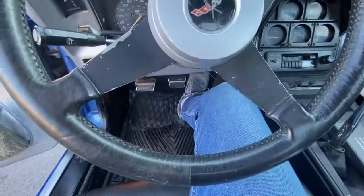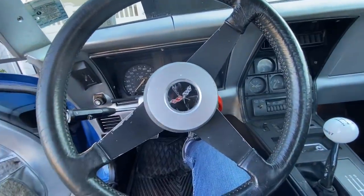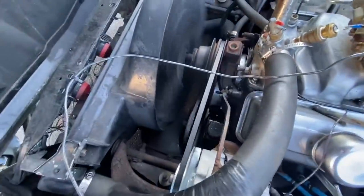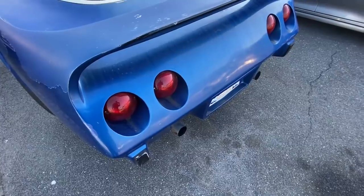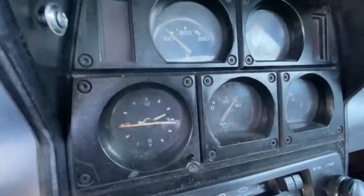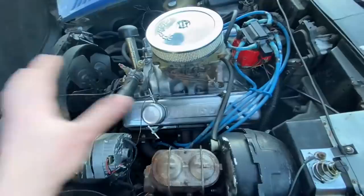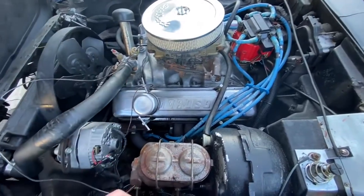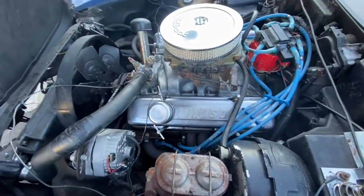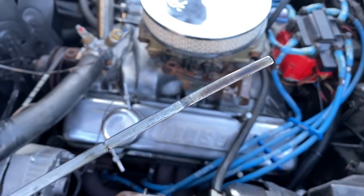I still have to sit here and just give it a little gas for a little bit, but not even close to the amount of time I used to have to do that. Just like that, it's already idling. It looks good down there. Definitely looks good. We'll cut it off for now. Every time I run it I do check the oil before letting it run for long, just because this is an old engine and it does have oil leaks. That takes two seconds and can save you thousands of dollars if your engine never locks up. I already wiped off the dipstick, so this is how much it has and it looks actually perfect. So that's pretty good — now we know that this is all good.